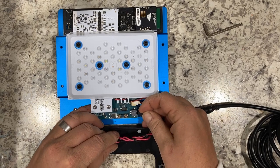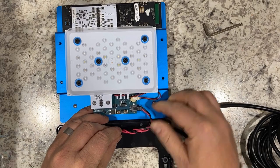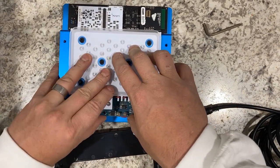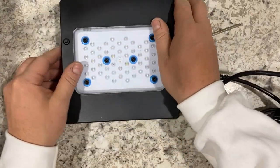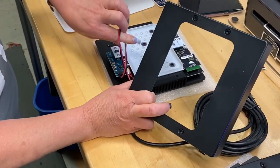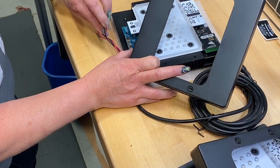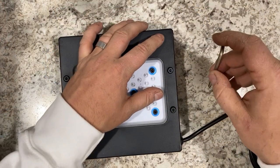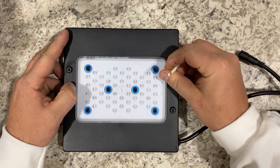Put the power connector back into the driver board. Put a little pressure on it to open it up, slide it in until it makes a nice clicking noise, and then push the wires under the driver board. You can then put the cover back on. Here it is again from a different angle — you can see the operator doing it on the line, doing a nice set of twists and then pushing it under the driver board and rolling that cover right on.